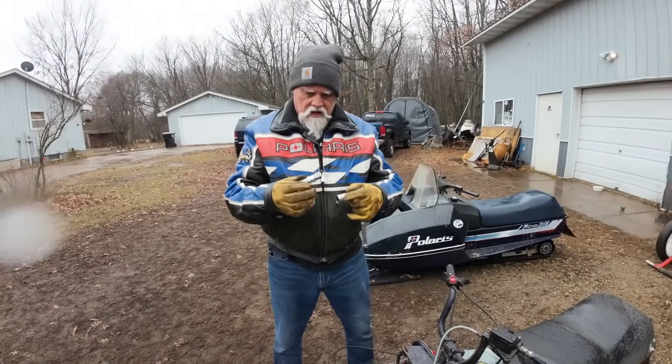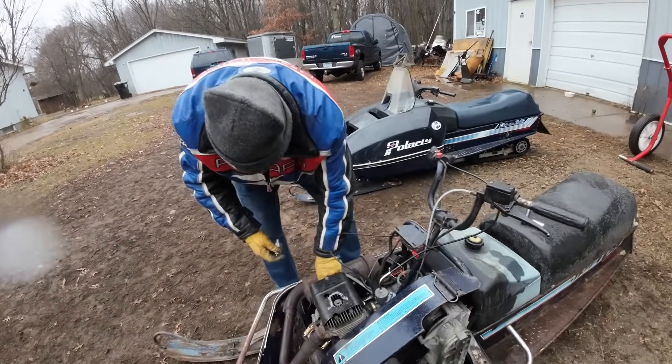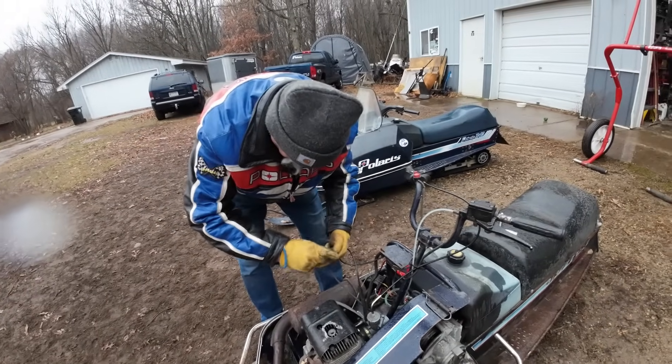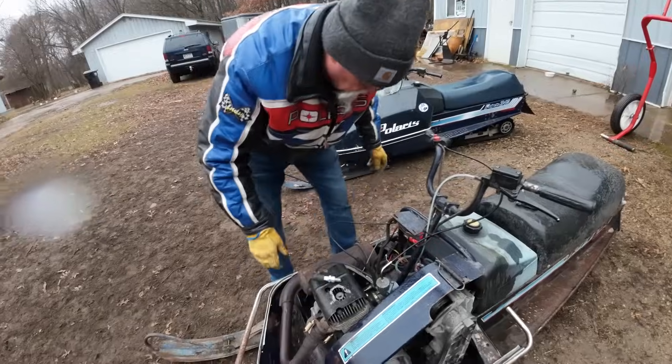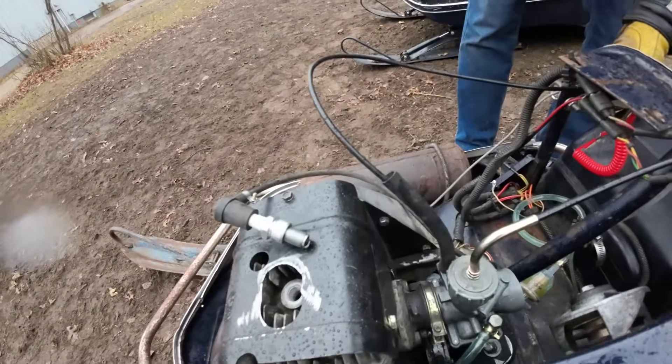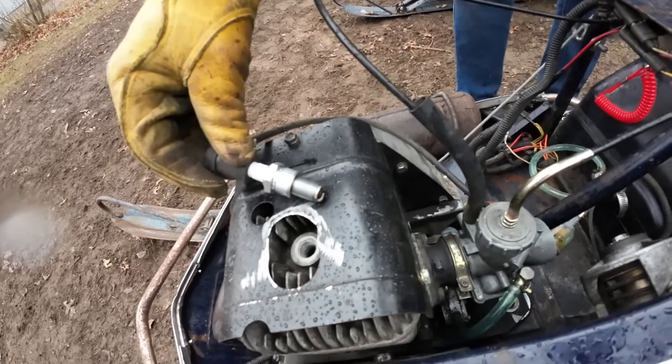The plug is not wet — dry as a bone. Plug it in and let's check for spark quick. If it's still dry we'll give it a little squirt right down the spark plug hole. I don't see any spark — oh wait, yeah, I'm seeing spark.